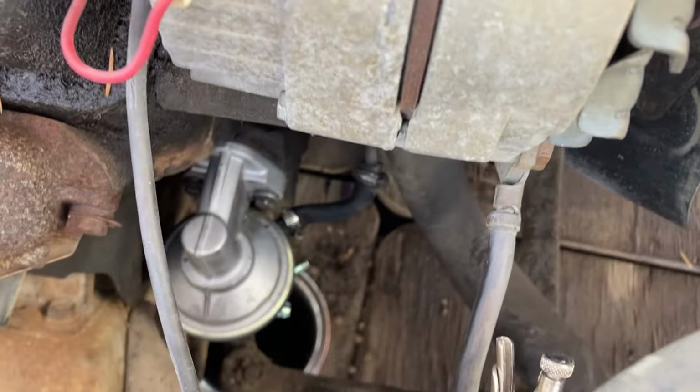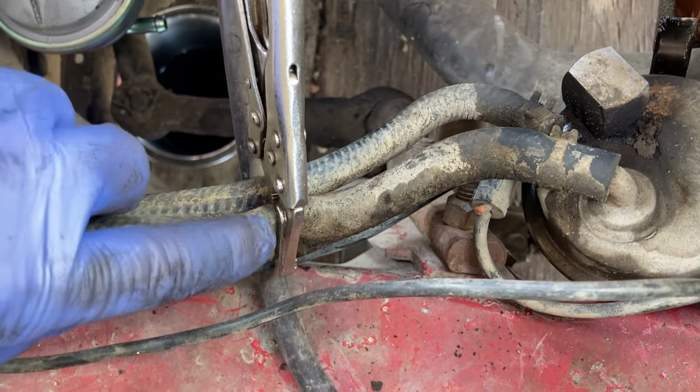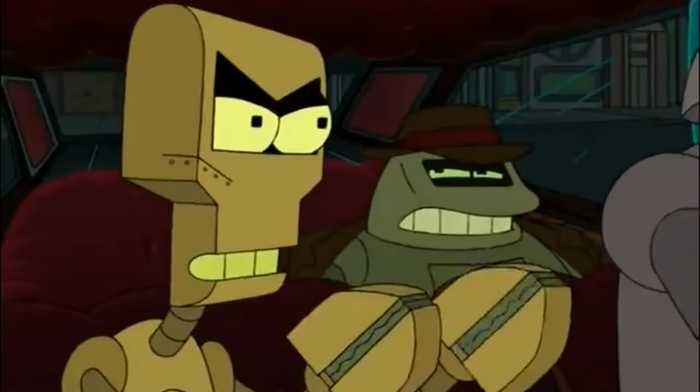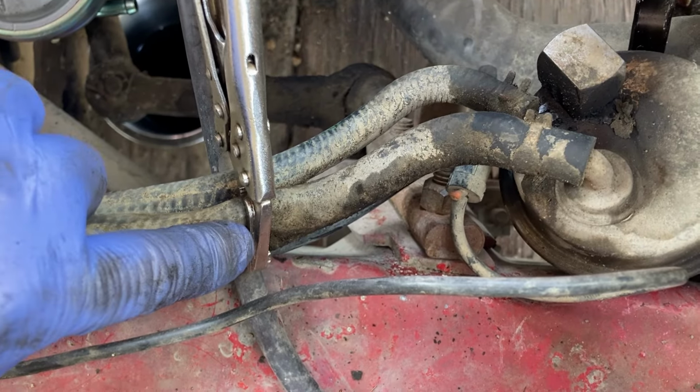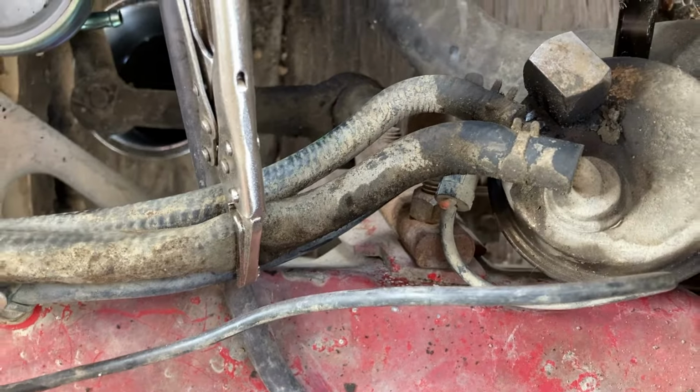I've got a new pump on. I got the first line on. What I do is I've got a ground down pair of flat vice grips that I use to pinch the line off so you don't leak fuel all the time. I plug the feed line off by just pinching it. I'm going to take these off, put them on one at a time. We should be good.